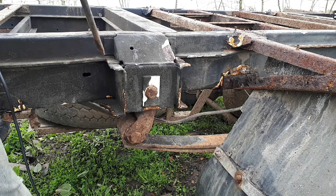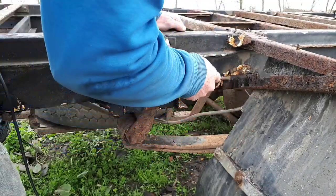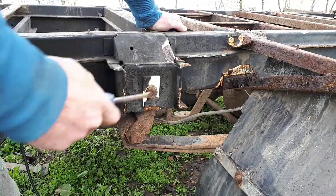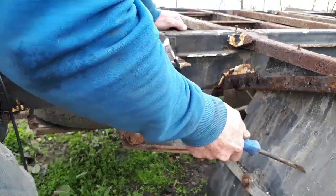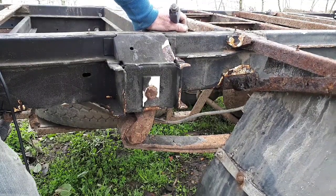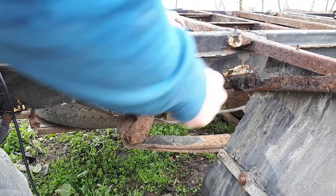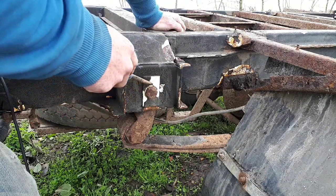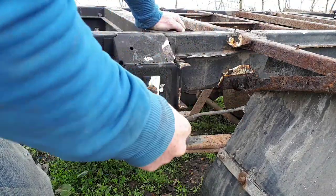Right, here is the driver's side rear spring hanger. Now, again, this is solid. It all looks good. This piece here has all started going rusty from this. Tell you what, I've seen newer Transits than this with more rust. And bearing in mind this hasn't actually had any plates welded. This here, gone. A bit more of that bodywork gone, and I'm not so sure as that isn't really that well connected. So yeah, that's kind of, yeah. But this outrigger, I mean, that underseal is probably 2 or 3 mil thick. But yeah, this is the rear spring hanger, and to me that looks pretty good.